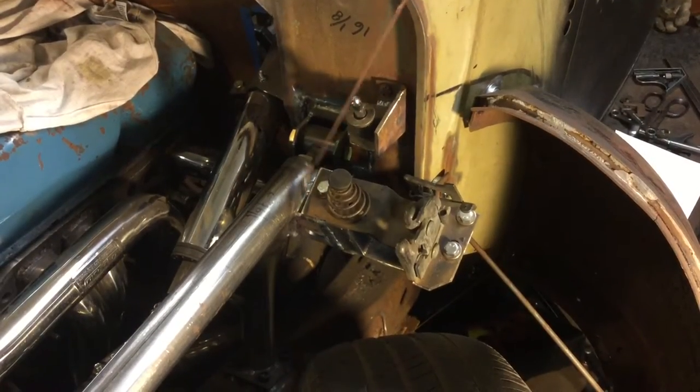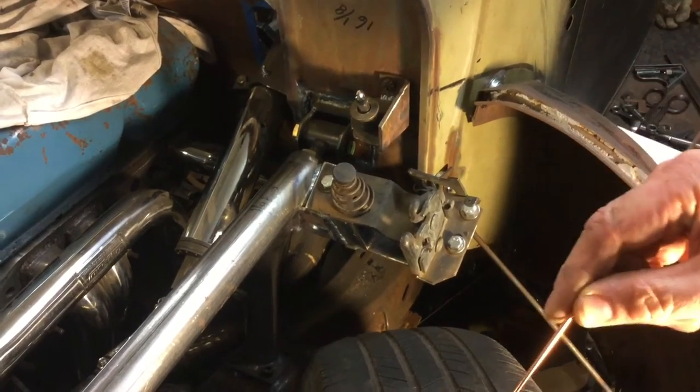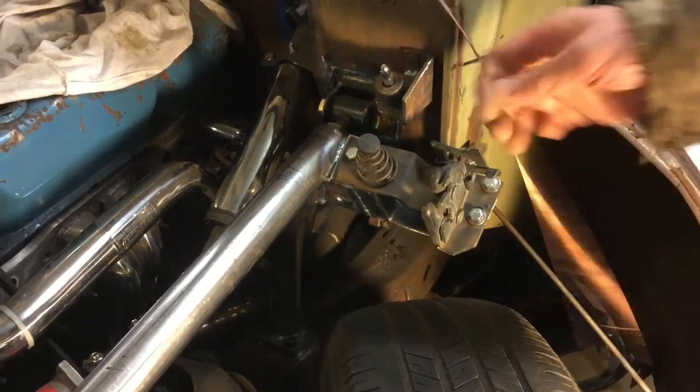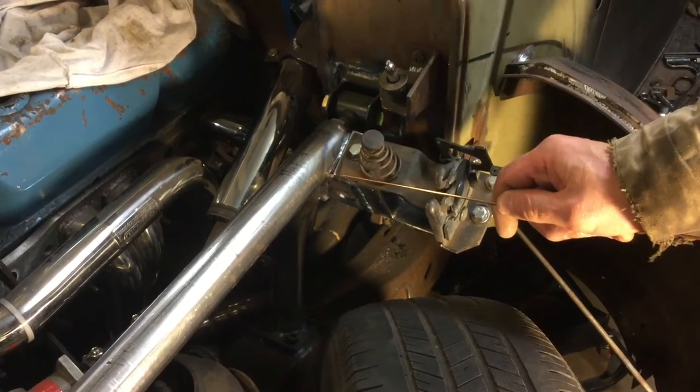This angle that this thing's on is slanted so that from here straight down to the pivot point on the roll cage, it's perpendicular when it sticks up. So whenever the latch comes down, it's going to come down nice and even down in this groove.